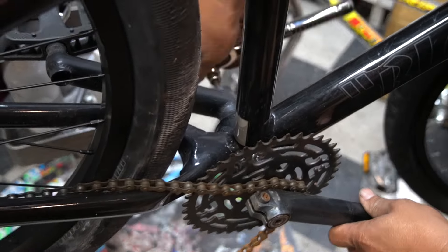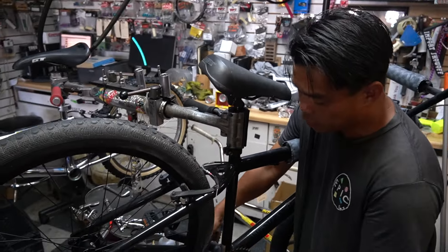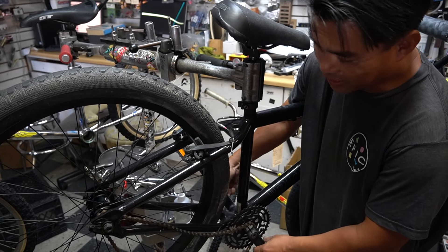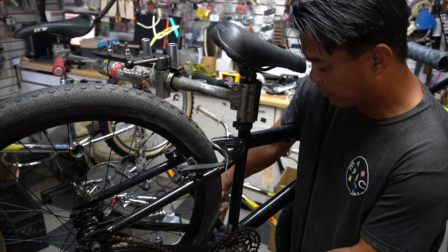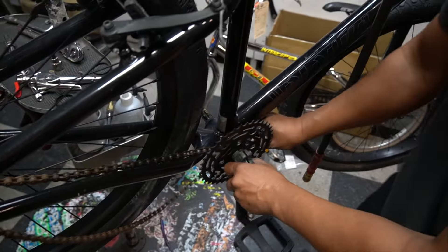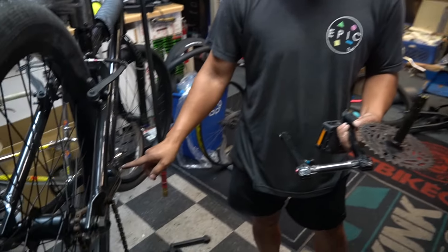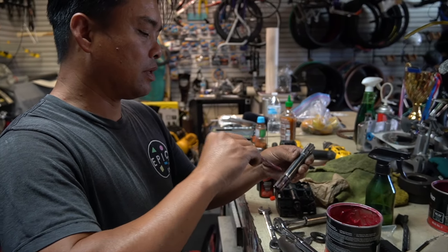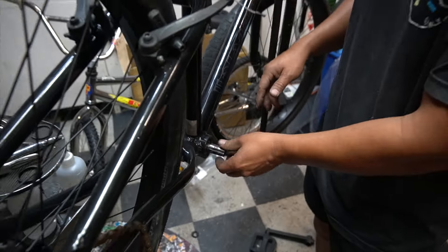All the bolts on this thing are rusted, so let's get this thing off. Now guys, you might say go ahead and change the chain too, but this chain is still very flexible. The rust is not bad - I'm going to wipe it down, put some lube on it and it should be perfectly fine. The spindle on the new crank and the old one are the same size - 19mm - so the bottom bracket is going to fit. He doesn't have to change it. These things always move even when tightened down, so it doesn't hurt to put some grease on them.